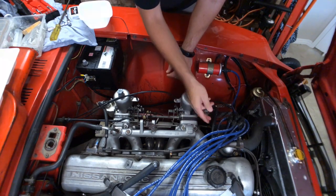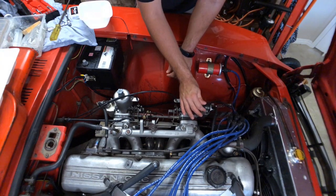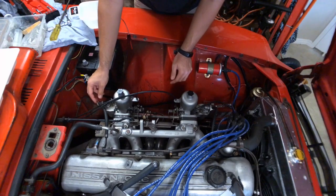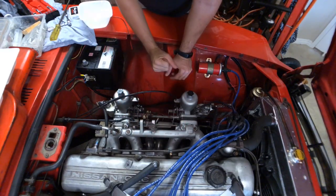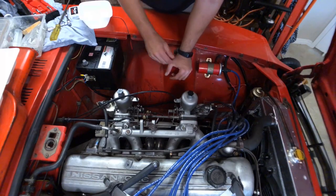This has been sitting for a while, so it's unlikely that much fuel splashes out, but always be careful. We don't want any garage fires or any injury occurring. I'll disconnect the fuel hoses first. You could leave them on and turn it around, but I think you need to get up at a good eye height to do this properly. So I'll take all the fuel hoses off and then we'll get these fuel floats out.